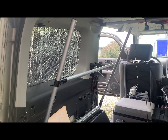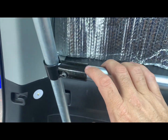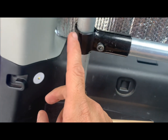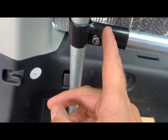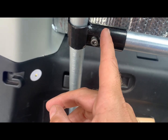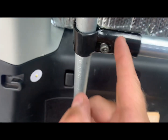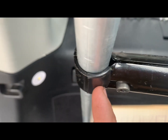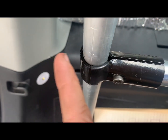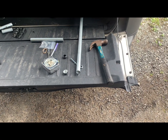The front vertical is an inch longer than the back vertical — the Honda Element slopes forward as it goes. The horizontal piece in between is 29 and a quarter inches. I'll have all the measurements below. When measuring these out, there are a few cool tricks to remember: the connector adds an inch on one end, an inch on the other, and then catches onto an inch of the pipe — so in total a connector spans three inches.